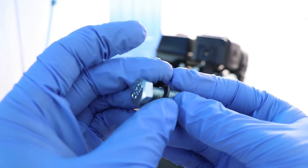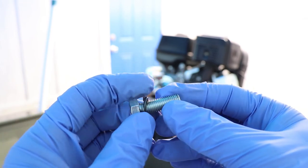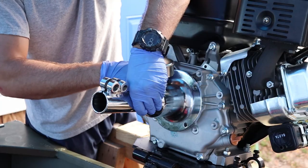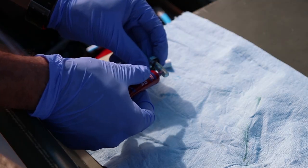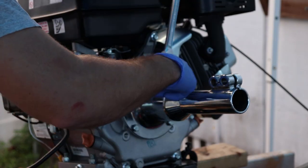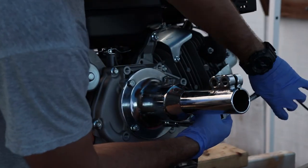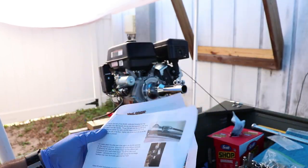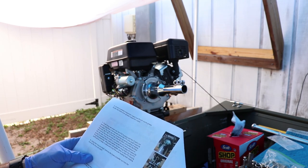There are four lock washers in the bag — the instructions didn't say what they go to, so I'm going to go ahead and put them on here. I'm also going to use some Loctite, which they didn't specify, but all the other kits do. Steps one through five are now done. Now we need to screw in the grease inspection cup and fill with marine grease.